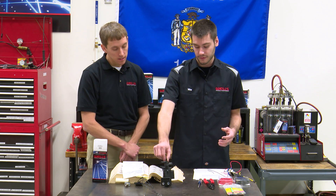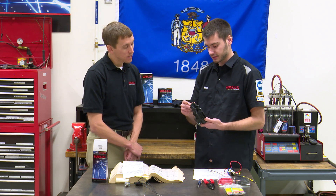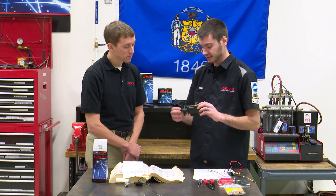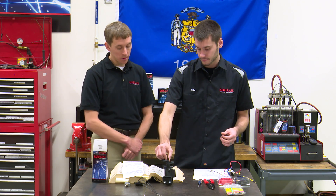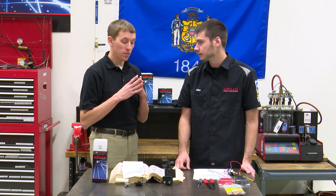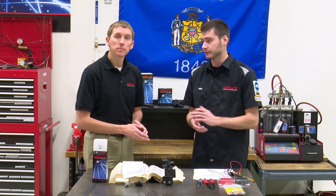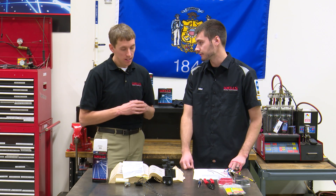Let's talk about this part here. We've got a bunch of little nipples on here that you're going to attach hose to. This has six lines on it. We also have a different one — when the return lines aren't required, you have an FSV-1. The FSV-1 is for a returnless system, one that doesn't have a return fuel line. This FSV-2K is for a return-style fuel system.